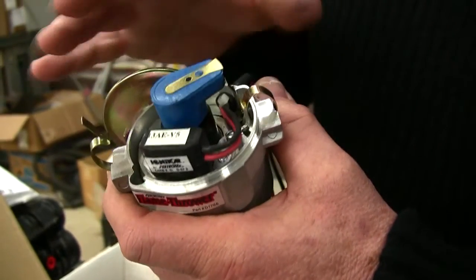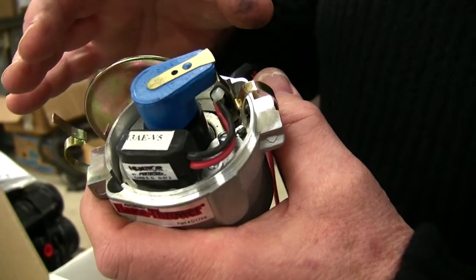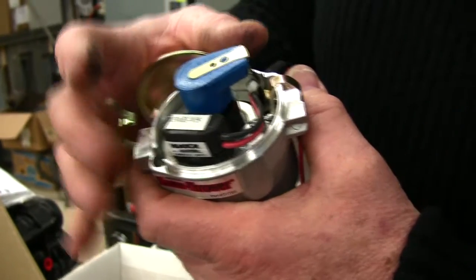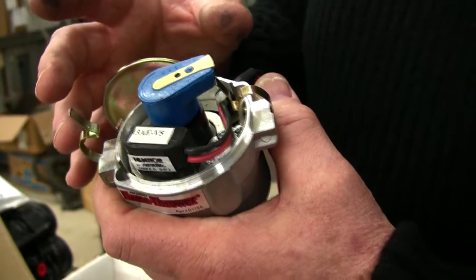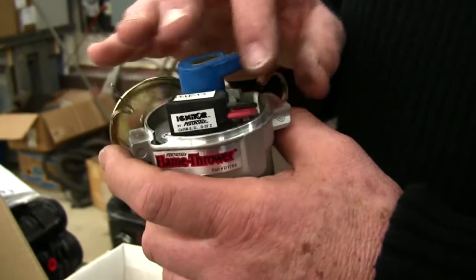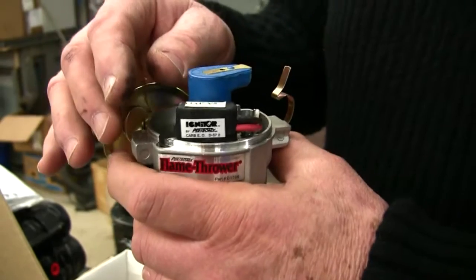As soon as it shorted, the car quit, and you lost the vacuum, and the plate returned to its natural position where it began firing again. And then as soon as it started firing and the engine started running, you got vacuum, and it would quit again. So for a while, on the road, the car was surging. At the same time, every time it does that, you get a dead short, so the wiring all underneath the dashboard began burning up.